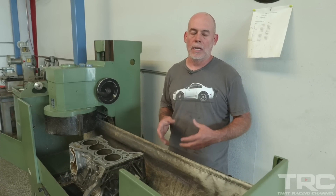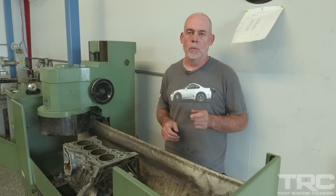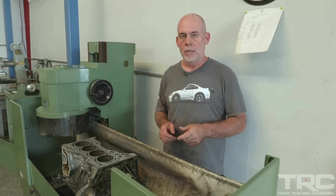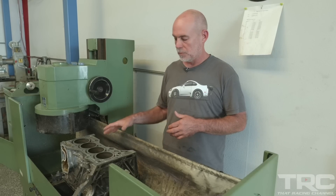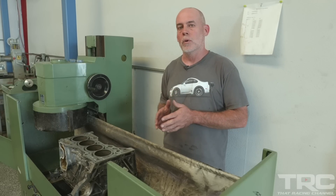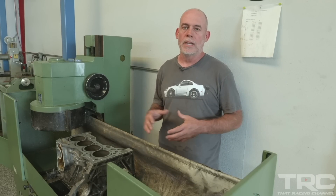If you are having a head gasket issue and you're going to fix it on a weekend, find yourself a straight edge and make sure that the deck is flat so you're not wasting time. Multi-layer steel gaskets only have three to four thousandths worth of spring memory to cover for distortion or warpage on either the head or the block deck itself. This block is now surfaced — it's a good illustration of how a deck can start changing shape under high stress, high horsepower conditions.